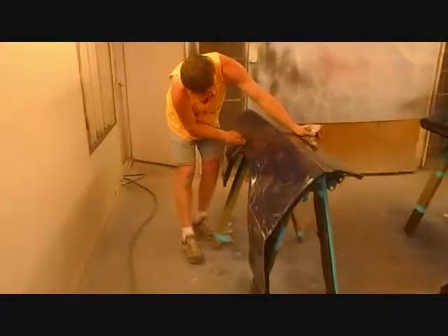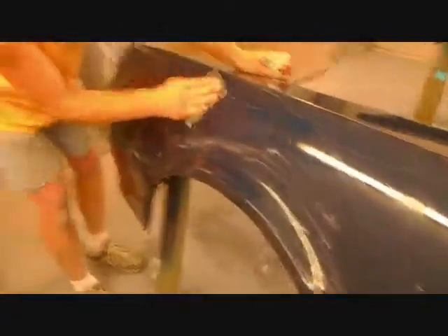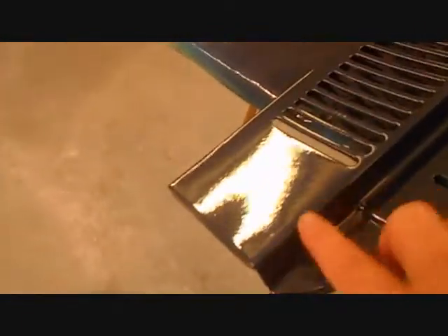Happy Labor Day Monday, John. Mike is wet sanding the finish that I painted last night. It's easier for him to do it off the vehicle — you don't want compound build-up inside the edges. I was going to take that down to 2000 grit and mostly wet sanded it. These look pretty good — we'll get this little bit of orange peel off of it.